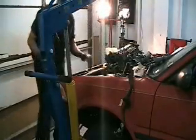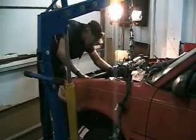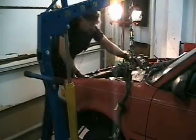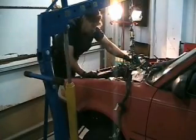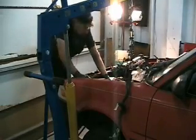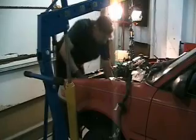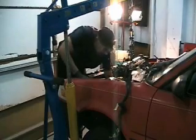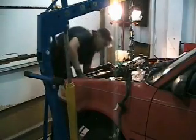We're looking pretty good here. The engine's just about halfway in there. I'm going to do something I almost forgot right now and I wanted to remind you too. When I got the drive plate onto the engine, remember the white paint marks I made earlier so I could keep the relationship of the drive plate with the torque converter? I've got the paint mark on the drive plate set facing directly down at 6 o'clock. What I'm going to do now is reach in and spin the torque converter to make sure that paint mark is also at around 6 o'clock, so I can quickly line up the bolt holes and get my relationship correct.